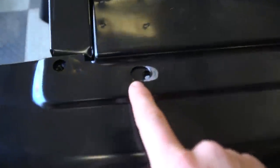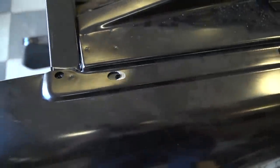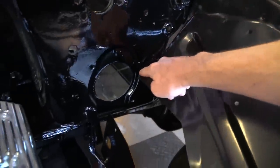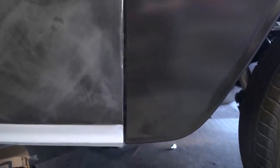You can see in this front fender that the bolt holes are actually already slotted to allow some adjustability. In this front one, we marked with a marker that we're going to need to trim it a little bit more to get it to fit perfectly. I'm going to have to trim the fender here a little more — we already trimmed it once, but it's going to need a little bit more to fit against the inner fender. We had to trim the inner fender right along here to get it to sit down low enough so that the fender would work perfectly against the door, and we have a little bit of a panel gap happening right here between the fender and the door. The front part of the fender needs to come down a little bit in order to get that gap a little tighter. On the passenger side fender, we need to trim a little bit there and back here, just like we did on the driver's side outer fender, and do the same thing to get that panel gap a little tighter.